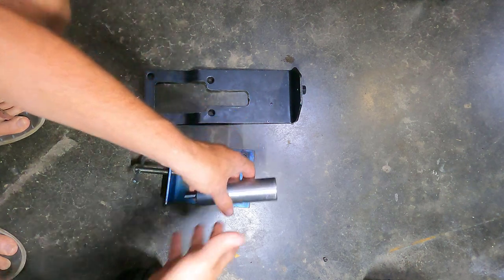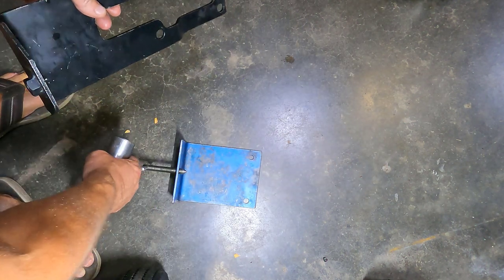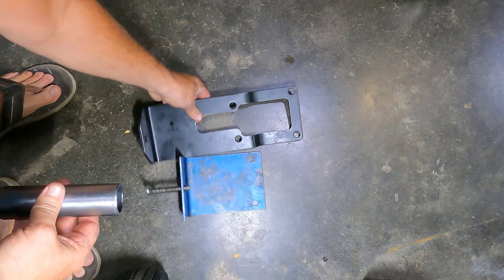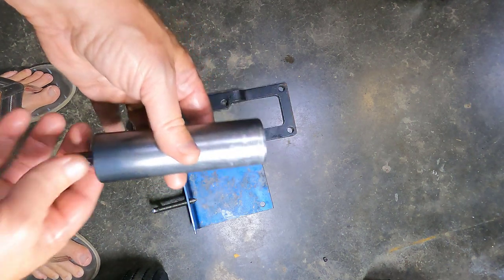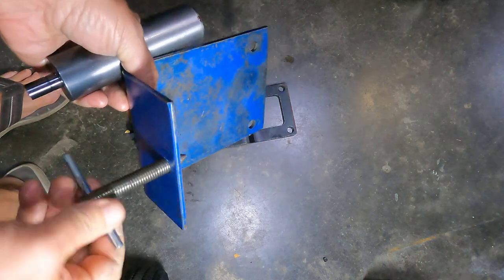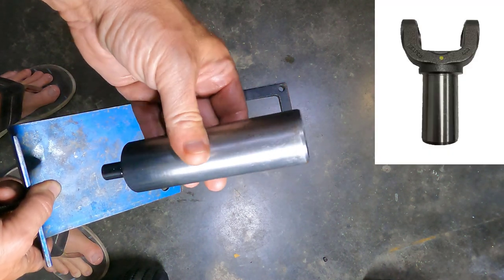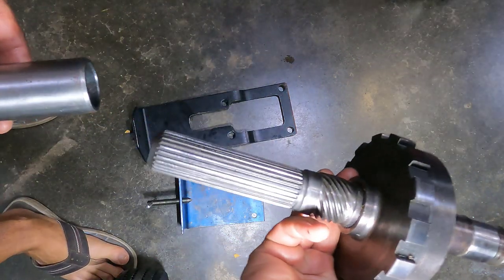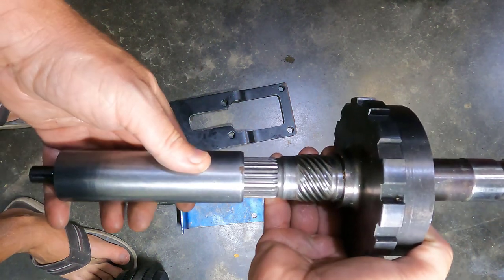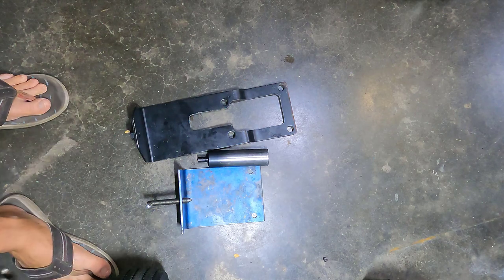The other tool works the same way but is shaped differently — I think this one was made by A-Tech. You take this screw and screw it in here, then this piece goes onto there, and then we move the output shaft up or down. Very simple to use. Instead of using this, you can make your own angle bracket out of metal — you can even use a piece of wood — and just get a screw, put it in the end. Instead of this piece, you could use a yoke, like a drive shaft yoke, that would fit into your output shaft. Get creative.